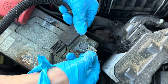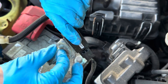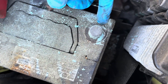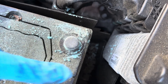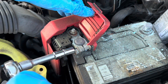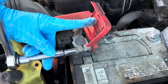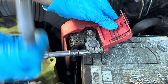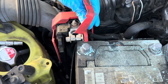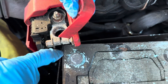So you just want to lift that out — there's some corrosion. Now do the same to the other side, the positive terminal. You never want to touch the terminals together. Make sure the wrench doesn't bridge between the positive and negative terminals.